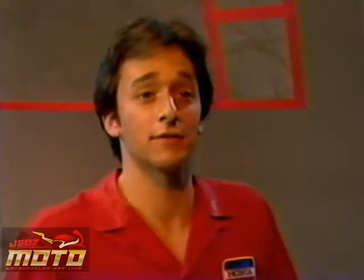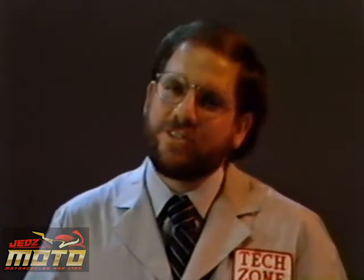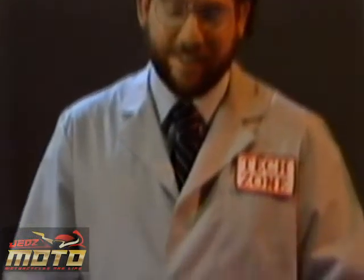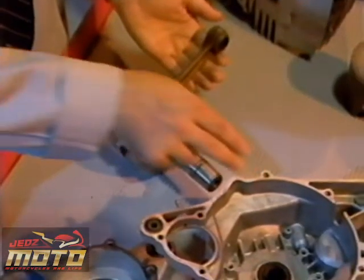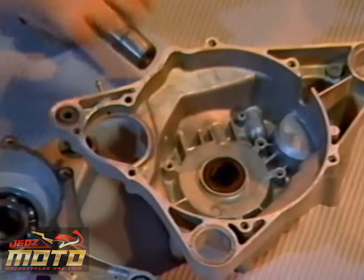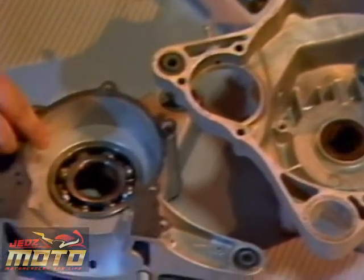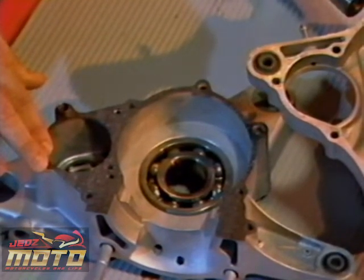You know, that crankshaft and connecting rod looks different than a four-stroke. A two-stroke crankshaft is different from your typical four-stroke crank. Because fuel mixture is pumped in and out of the crankcase, there has to be a positive seal on each end of the crankshaft. Honda uses a gasket to seal the halves of the crankcase together, and the crankcase is physically separated from the transmission.